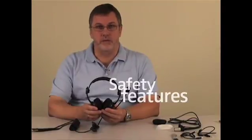When you're talking to ATC through the radio, there can be an acoustic burst. To protect you against this burst, we integrated a feature, peak level protection, and this feature just cuts the burst out. So if there is a high peak in the communication, you can imagine it's a very high signal that comes up very suddenly. We just cut it out, and so this is an additional protection for your hearing.